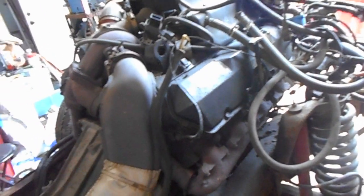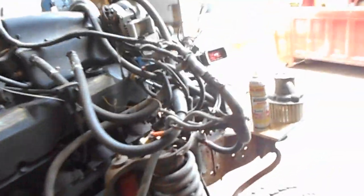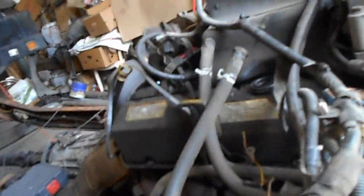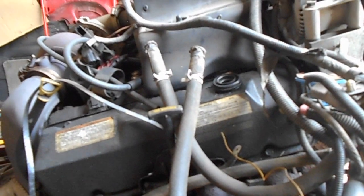It'll probably be raining by then — they're calling for rain today. We've got power steering lines to change. I'm going to get into probably, while it's down like this, put a new set of glow plugs in it, and check some of the wiring on the other side and this side too, because I noticed my little wire loom was burnt and melted. So one of these wires has gotten hot — I've got some checking to do there.